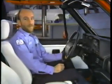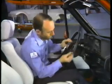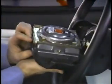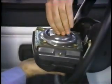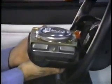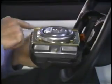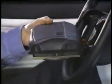Before removing the steering wheel, you'll have to remove the two Torx head screws at the back of the steering wheel to take the airbag unit out. Once both Torx head screws have been completely loosened, you can take the airbag unit and tilt it back. Now disconnect the red connector from the back of the gas generator. Never store the airbag unit with the gas generator facing up — always store the airbag unit with the vinyl pad facing up.